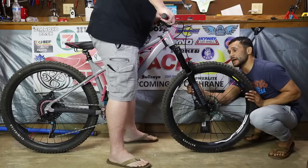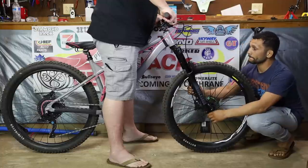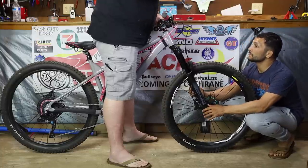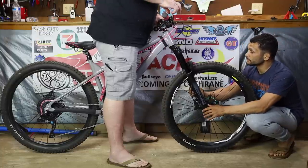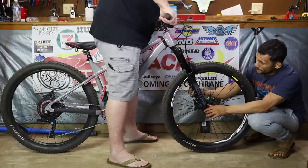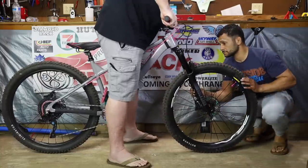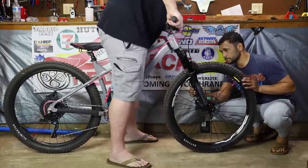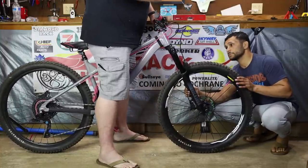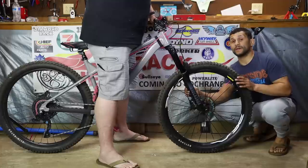Okay, I'm starting to feel it more now. You can hear that oil circulating. You know what this fork has, real quick before you keep going? It has that progressive feeling that the higher end forks that we've messed with seem to have. This one's the most so far I've felt. Right here, it's smooth and pretty easy, right? As soon as I go further, right there, you hear that? It becomes really difficult, so it progressively gets harder, which is what it should do. That's good, it's not soggy the whole way through.